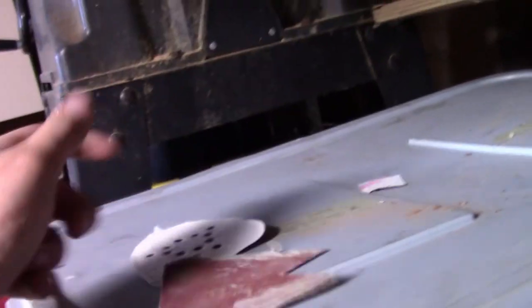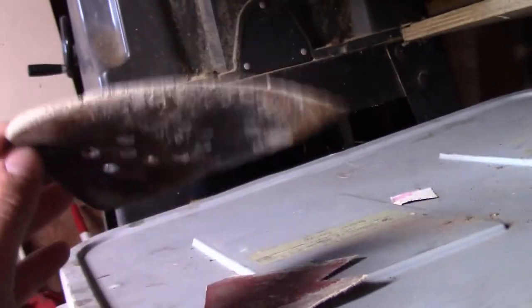There was a bunch of places to fix on the front of this thing, and I want to get it all very uniform. The bottom I didn't work super hard on, but that was because I didn't have the right sandpaper. This was the sandpaper I was using. It was 120 grit. Don't know the brand. But I went and got some 80 grit Craftsman. That stuff sanded this nice and flat. There's a little bit of a high spot. It was already a high spot. It's gotten expanded somehow. But there was a crack there, and you can hardly tell it's there anymore.